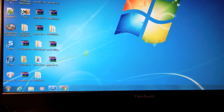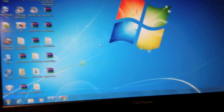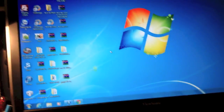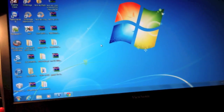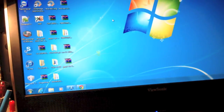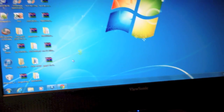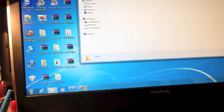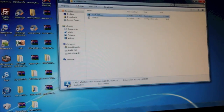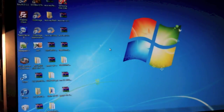Before we start doing anything, we're going to need to prepare your computer for flashing. The software you're going to need is the Samsung Mobile USB Driver. I'll put a link to all this software in the video description. The Samsung Mobile USB Device Driver is an installer package, so you'll just run the installer and that will be it for that one. The next piece of software you'll need is called Odin. And then the files you'll need to flash to the device are as follows.